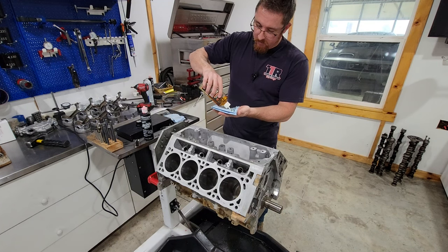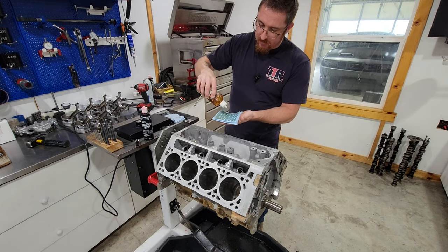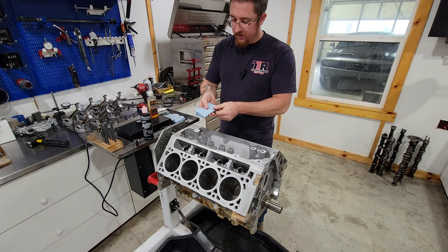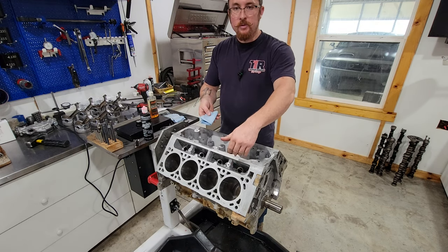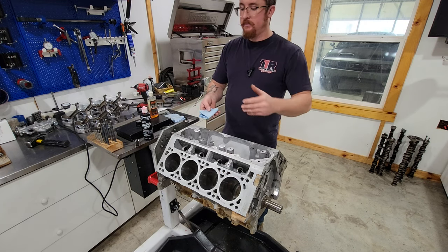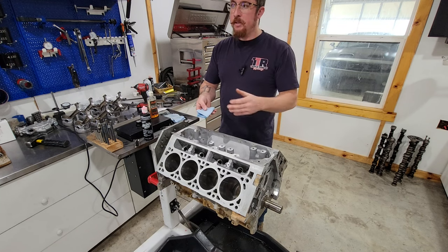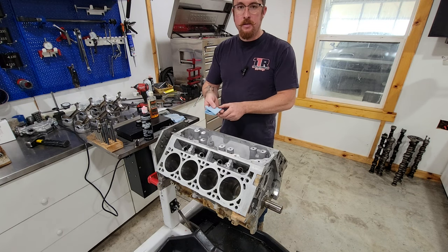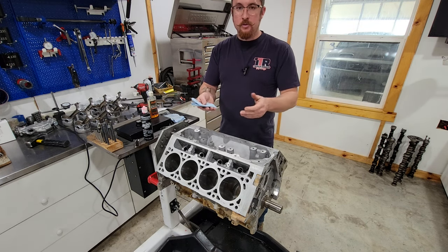So the last thing that I do before I put the pistons in is I clean up the cylinder bores with some oil and a clean rag. Now we do a, I guess you can call it a 3 or 4 stage cleaning process where we will, after honing, take some Gojo or like a pumice soap and go through and try and get all the grit out of the hatch that way. Then we'll wipe all that out. Then we'll put it into one hot tank. As it's coming out of that hot tank, we'll wash it out, blow the cylinders out, put it into a second hot tank that runs just the cleaning, like a final clean, to make sure that none of the grease or the grit or anything else is in the final clean motor. And then the last step is taking some of this and wiping the cylinders out to make sure to get all the extra grit out of it.